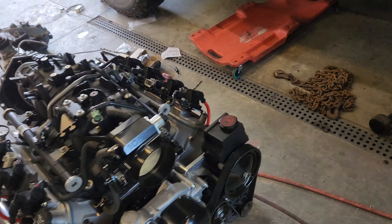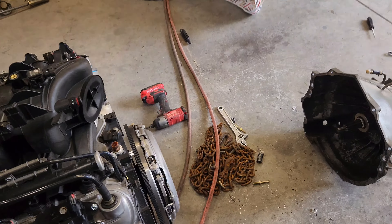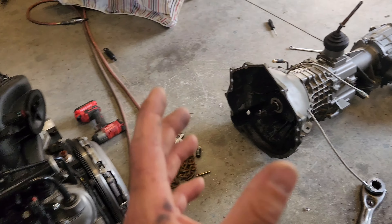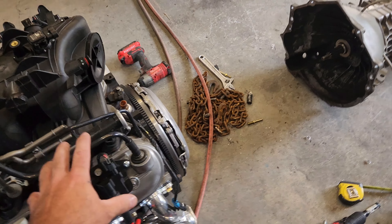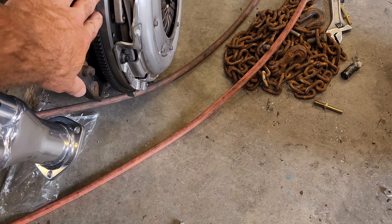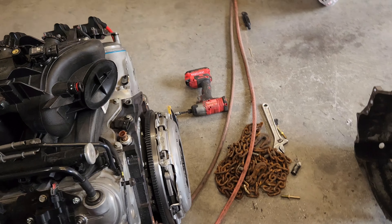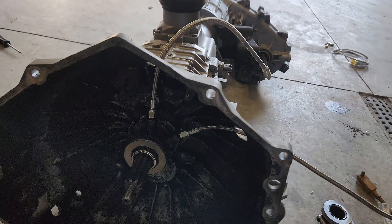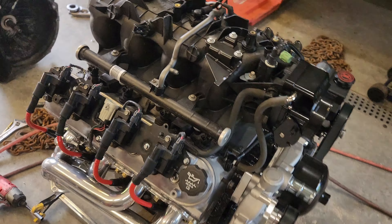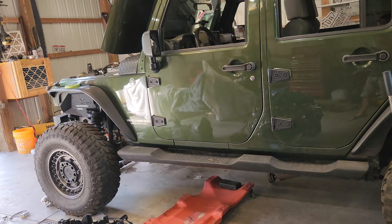If you're going to use a 700R4, you will need an adapter spacer, but you can bolt that up — you just need a spacer for your torque converter. If you're going to use a manual like I did, the NV3500 transmission, I basically took a 4.8 flywheel and 4.8 clutch off a 4.8 LS and bolted that all up, then did a hydraulic throwout bearing setup. So this is all ready to bolt up, and I'm going to bolt it all in and start working on swapping it into the Jeep after I finish this video.